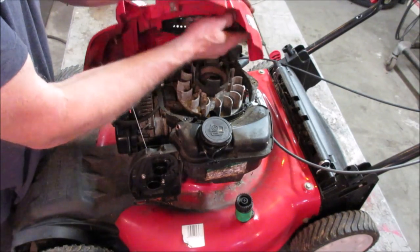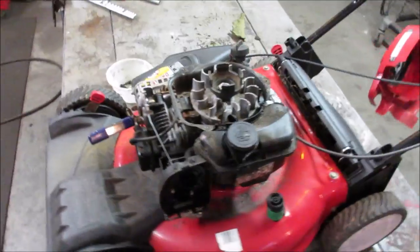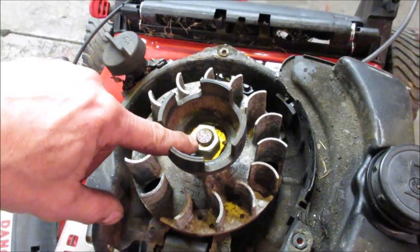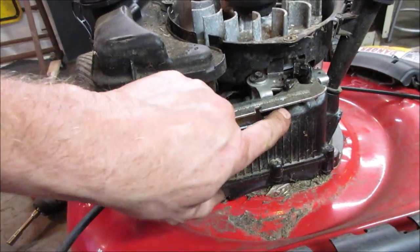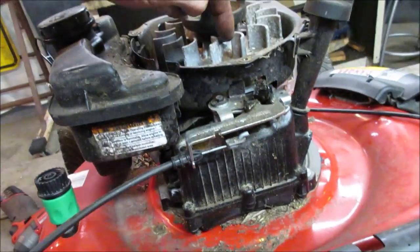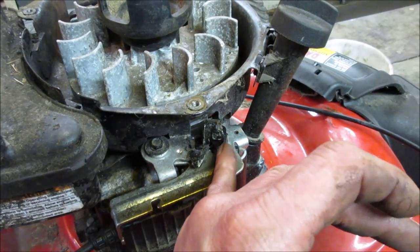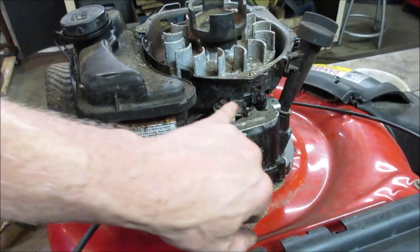Let's pop this cover off and see what I was talking about as far as not making ground. It's pretty common on mowers for no spark — on generators it's generally the low oil shutoff. It looks like somebody was possibly in here and cleaned out a rat's nest — it had a mouse nest in it and somebody actually took it all out. Also, if you hit something real hard it'll shear the key. Here's that cable that pulls from up above, and it has a ground wire that goes to the coil or magneto which is underneath the flywheel.